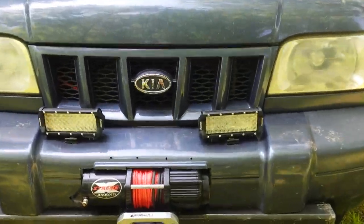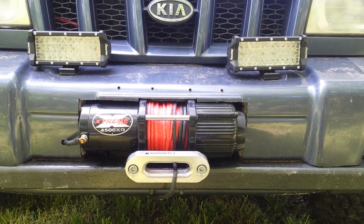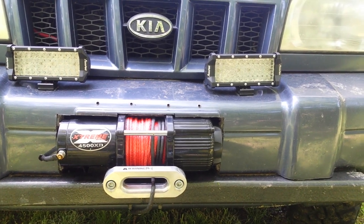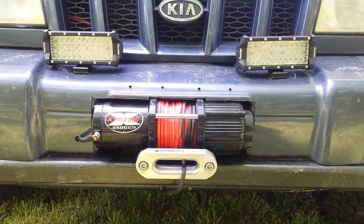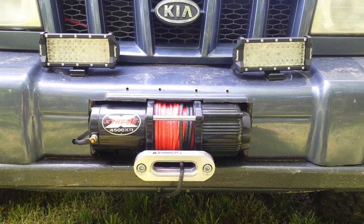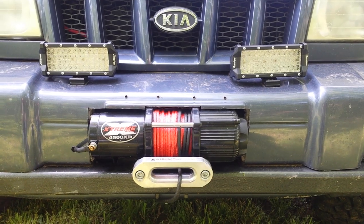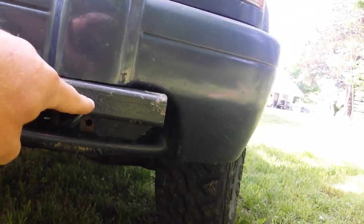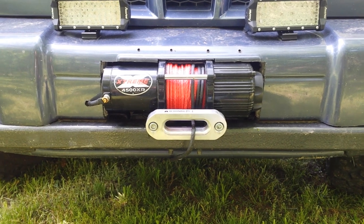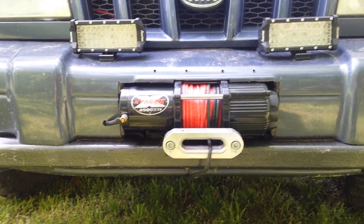Winch number one — because this vehicle is lightweight, I chose a smaller winch. This is really an ATV-rated winch, probably made for a heavier side-by-side like a four-seater. It was marketed as an Extreme XD 4,500-pound winch. This wasn't a money factor — I could have definitely afforded to stuff something bigger in there — but my experience is it takes a lot less of a tug than you'd realize. I've had this thing buried to the frame and this little winch pulled it right out. When I first got it, it had little receivers already bolted to the frame, probably from a tow bar, and those things are box beam with about six through-bolts through the frame itself — thick and tough.